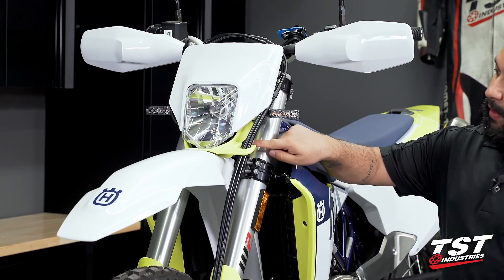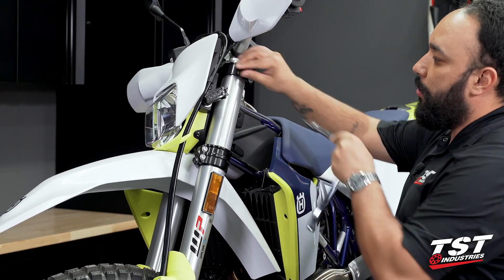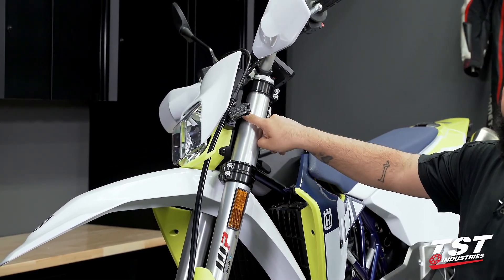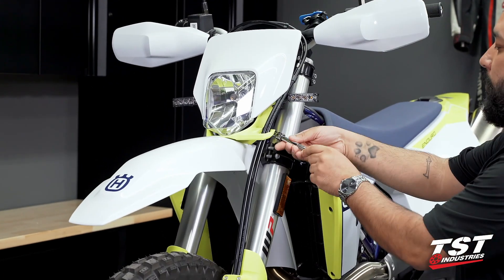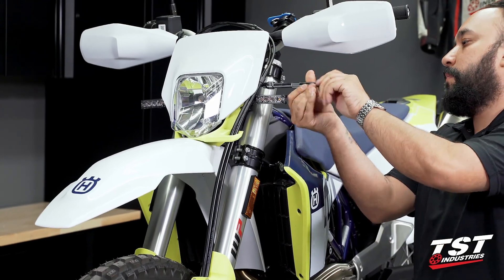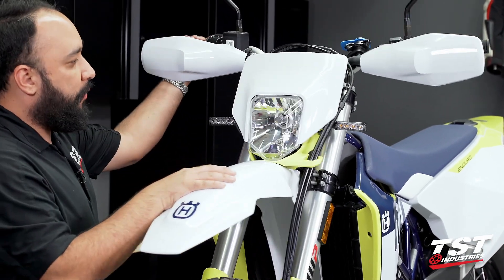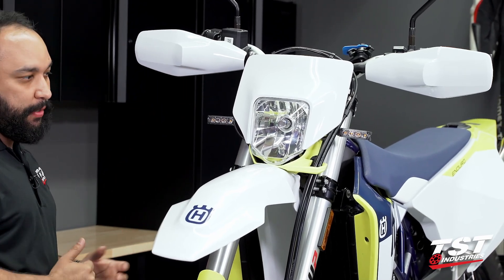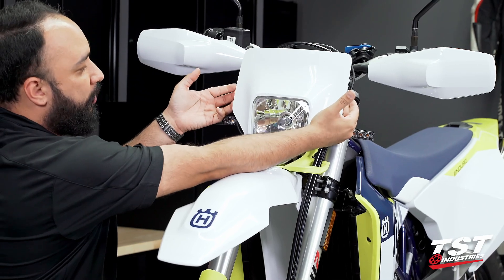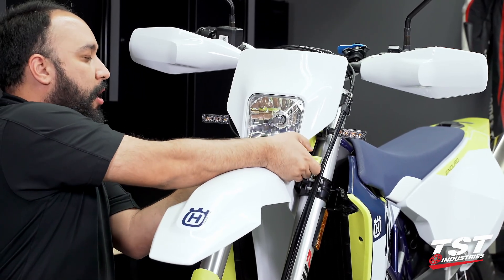Alright, let's grab a motorcycle and continue with this install. Begin by removing the two bolts located on the left side of the headlight shroud — we have a lower bolt and one located just above our LED turn signals. On the opposite side there is a bolt located in this exact location but on the right side of the bike. As you remove these bolts, ensure that the shoulder washer is removed with them. With all the hardware removed, we can focus on removing the headlight to gain access to the OEM flasher relay. Place your hands on each side of the headlight, pry in an outward fashion, remove these cables from their holder, and gently pry upward.